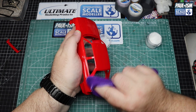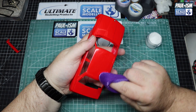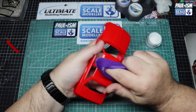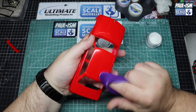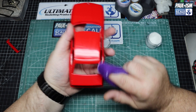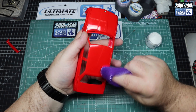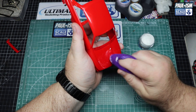The 2K is fantastic - the Gravity Colours stuff is absolutely brilliant. Dust is our enemy sadly; if it wasn't for the dust you could almost leave the 2K finish alone, but it does benefit from a sand and polish to get the best out of it. We'll be very careful on edges and raised areas because the paint will be inherently thinner there and it's very easy to burn through. Use straight forward and back patterns with abrasives, not round and round.